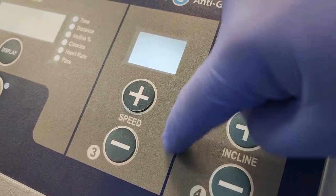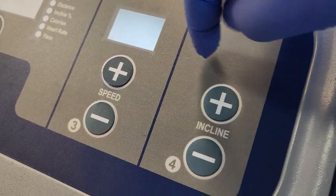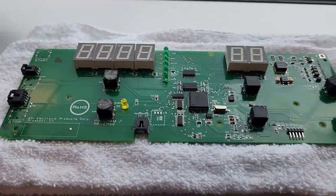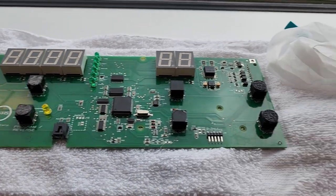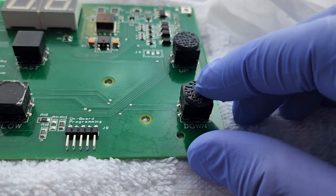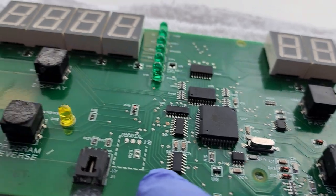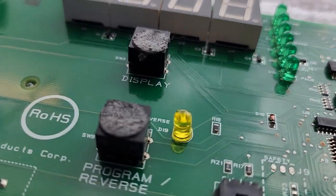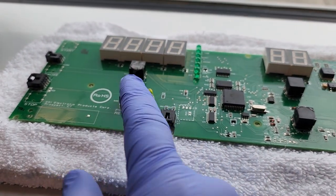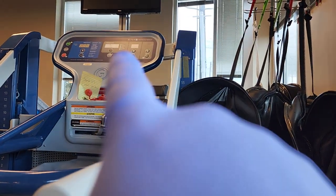This is usually indicative of either a circuit board that's loose behind the rigid platform, or something else going on — which is what we have here. These little risers right here are foam, really nice, but you can see how they're adhered to the top of the buttons. What happens over time is they degrade, and as they degrade they often just slip off or pulverize to nothing, which is what happened here — which is why those two buttons were pressed in.